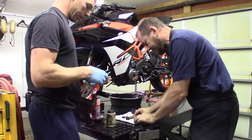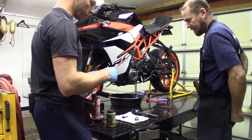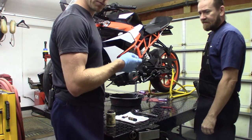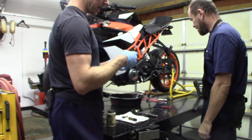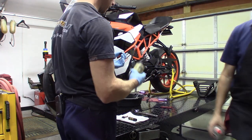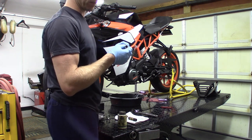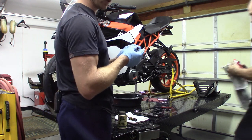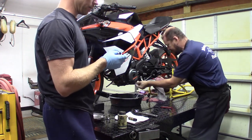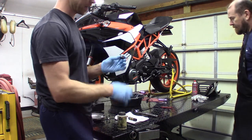Now that we have the filter screens cleaned up really nice and all the debris is out, we're going to go ahead and start with reassembly of the drain plug. Especially since these are aluminum drain plugs, we're going to use a little bit of anti-seize or moly — anything similar. These are not to be over-tightened; they take very little torque. Please refer to your owner's manual or service manual to see the specific amount of torque. Be very cautious with them — they will break, they will crack.